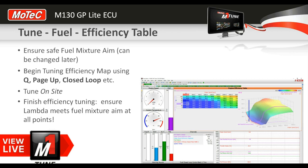Right, so the idea is that we tune on site. So I'll show you what that means shortly when we switch to the live ECU. And effectively, once we get a bit of an efficiency map roughed in, we move to other parts of the tune, such as the ignition and boost control.